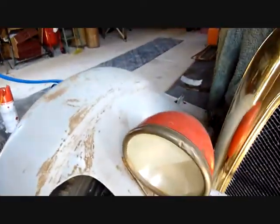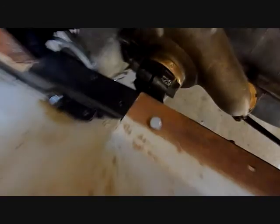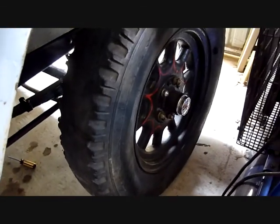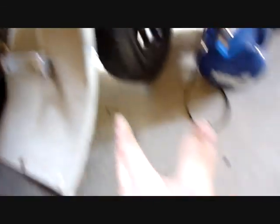Our guards actually fit quite well; we've only got a little bit of work to do on them. This one here is rusted out where it meets the radiator down the bottom — it's got a little crack there and rusted out where the bolts go to hold the running boards on. You can see this bracket here — that's the original part, but it's been folded out to accommodate the larger wheels put on in the 40s. It had the smaller 16-inch rims, and the 19-inch rims were narrower, so they'd have fit in; they had to open them up to fit the bigger wheels.